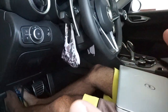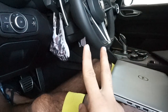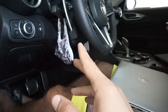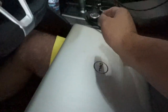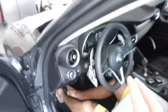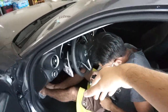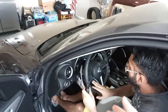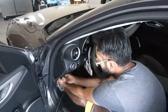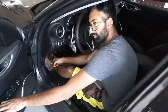So this is how you code in the button. We just found out there are two software options — Type 2 and Type 3. When you put the car in Dynamic it gives you all these options but nothing comes up in the cluster gauge. We want the modes to show in the cluster gauge too. There's no actual Race mode so it won't turn off the traction control fully, so we're gonna try Type 2 to see if that works better.